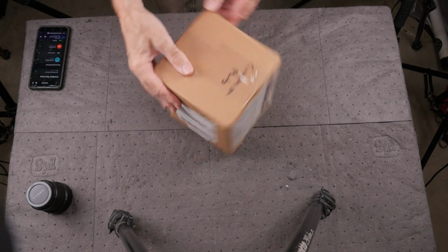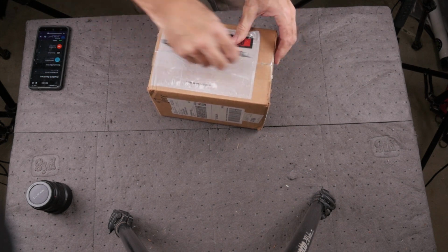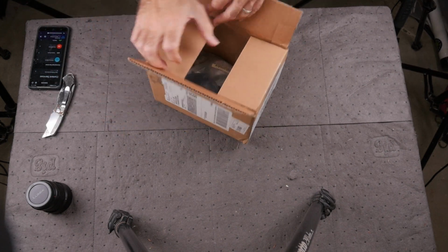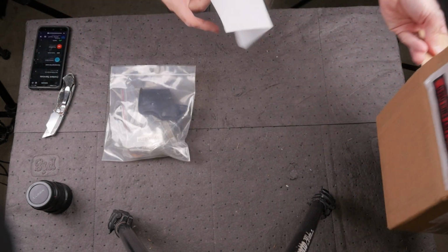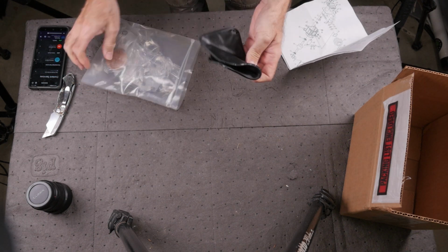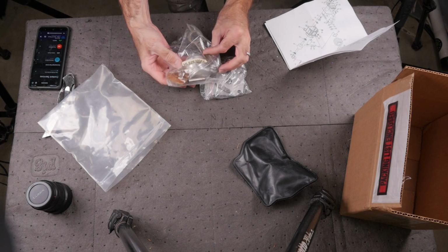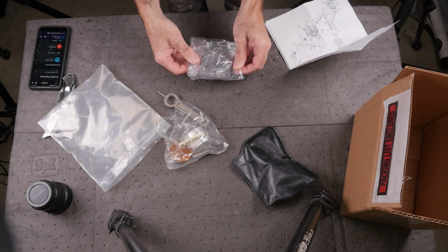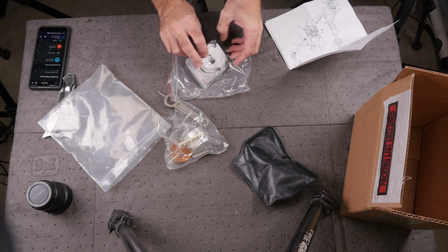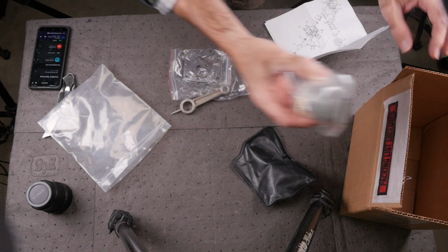When I had my oil leak issue with this compressor, I bought a number of extra spare parts just in case. Fortunately, I was able to remember where I kept that box of parts. If you're curious, I'll leave a link to that oil leak fix here. Among the spare parts are a new oil diaphragm, a piston kit, and the bit I need, a valve rebuild kit, which consists of a valve plate, a valve reed, gaskets, and locator pins.